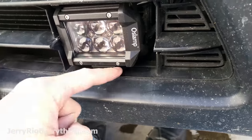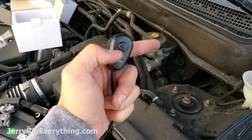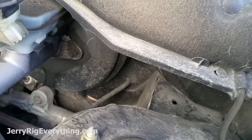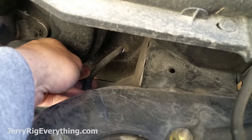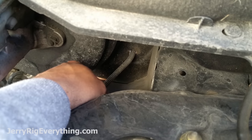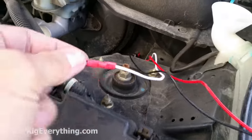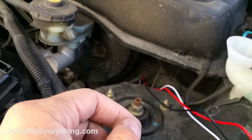It has two screws in the back holding it to this metal plate and that will allow it to adjust up and down. Somehow you have to get the switch inside of the cab of your car so you can turn the lights on and off from the inside. Every car is a little bit different, but this particular car has a little hole right there inside of the firewall where some other wires are going through. I'm going to maneuver my way through this plastic sheath and get my controller inside of the car. If you can't find a hole through the firewall you can always drill one, but that's a little bit dangerous. The plastic connector was a little too big so I ended up feeding the black and red wires through, cutting the white wire, and splicing it back together again once I fed it through — so that little white plastic connector is on the other side of the firewall.